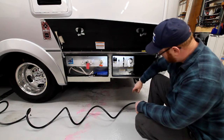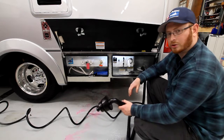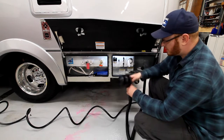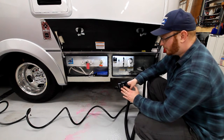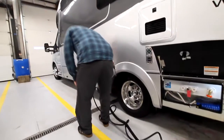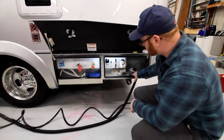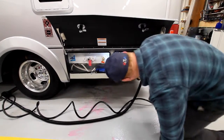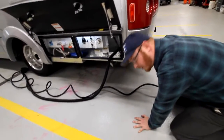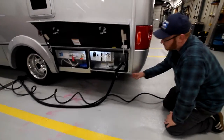Down here is our water closet. We have a macerator — this is a pump right here. That will attach to this hose. This hose is retractable and extends so you can reach the dump station. On the end of this, there is a cap so you can keep everything nice and sanitary. The reason this has different-sized holes is so it fits dump stations with different-sized pipes. To use the macerator, we are going to dump our black tank. Our black tank dump is located all the way at the rear of the unit, right here.